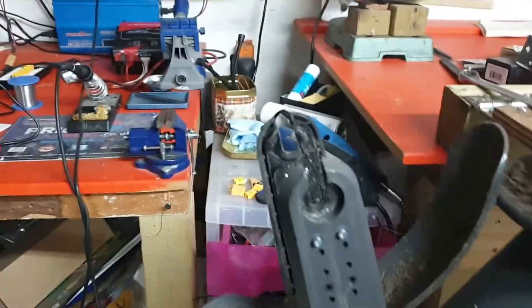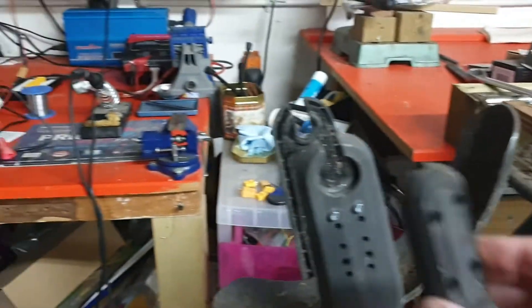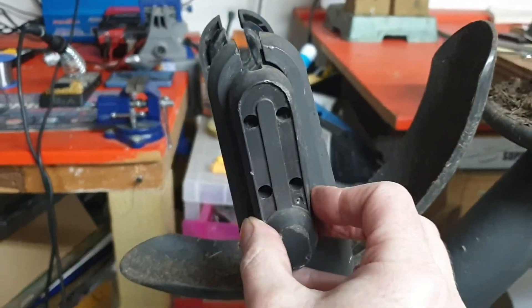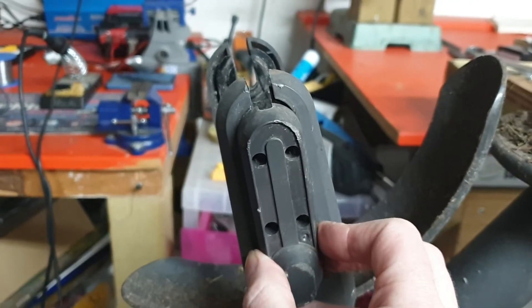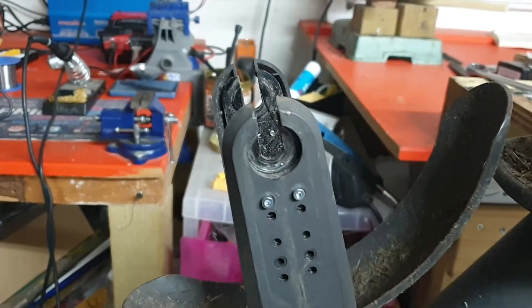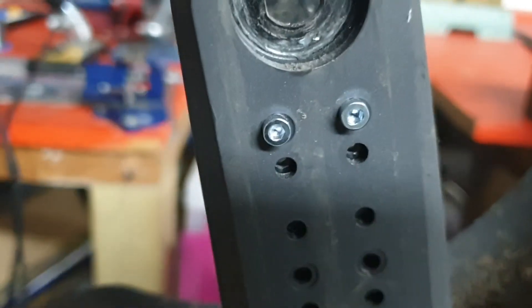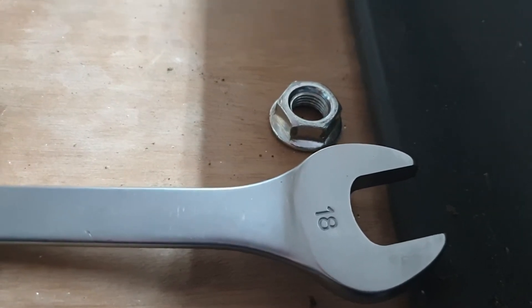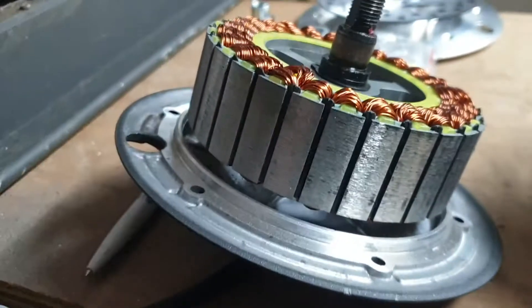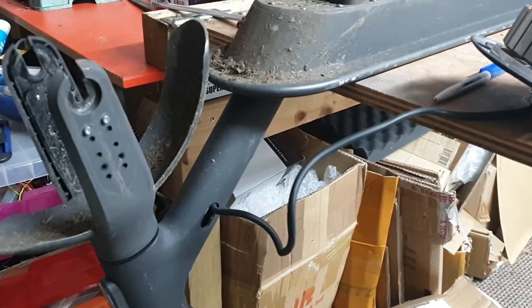My other video shows how to take this motor off, but for people who haven't seen that: you peel back the reflector, which reveals the four screws — do that on both sides — then this part is removed. You don't need to remove these two. Then you've just got the nuts to remove, so you will need an 18mm spanner to remove both nuts. You do not need to remove the wires for the three phases to the motor. You can get this motor out like how we've got it set up here, sitting on the bench.